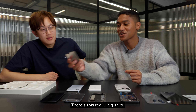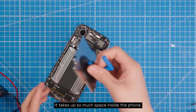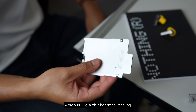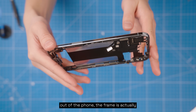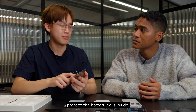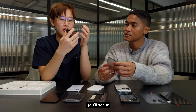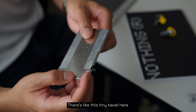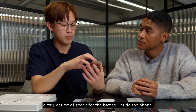There's this really big shiny metal thing — and that's the battery. The battery in the iPhone Air is huge; it takes up so much space inside the phone. Conventional phone batteries start with a thin layer of aluminium foil, compared to this thicker steel casing. The steel case battery serves a dual purpose: without it, the frame is easier to bend, but the steel case adds stiffness and rigidity to the phone while also protecting the battery cells inside. Apple have also used a non-rectangular, custom-shaped battery to squeeze out every last bit of space, with a tiny bevel where the camera button is.